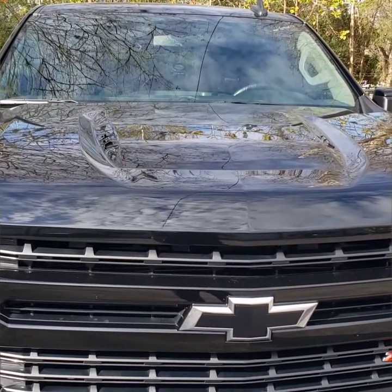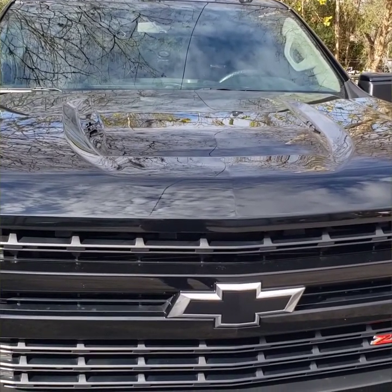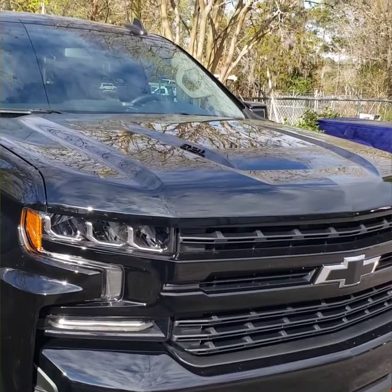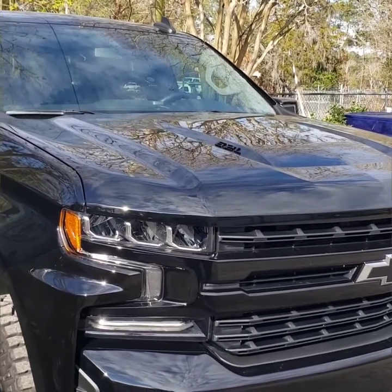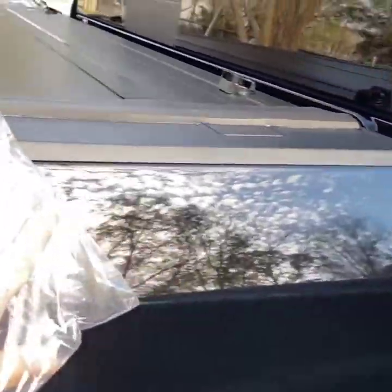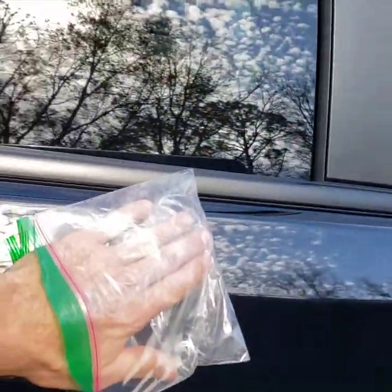I'm thinking it's gonna need clay bar, iron remover, and wash before we even bring it inside. And hopefully the fine clay bar will get it, being it's a fairly new vehicle, and we'll bring it inside to do the polishing. So we've done our decontamination, and I'm now running over it, and we still have a little roughness, so we're gonna bust out the fine clay bar and get busy.